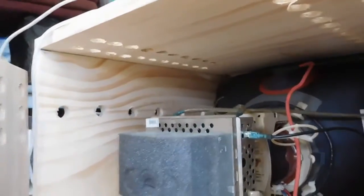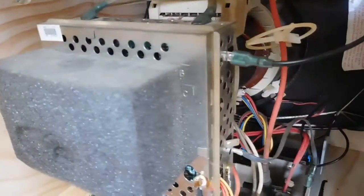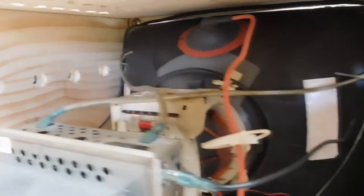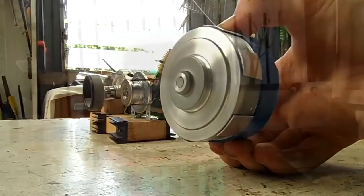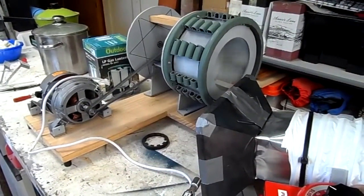Nothing much to see, really, but this is where your crackling noise comes from — it's actually the neck board grounding out. There's a new Flyback Transformer, and there's the little relay there that activates the degauss coil. See if we can get the glow of the CRT — you're really not supposed to do this with running computer monitors and I do not recommend anybody try this — but you can see the neck there should be glowing. That's my old computer monitor. Thanks for watching. Bye.